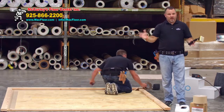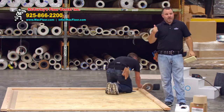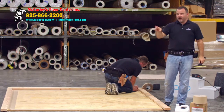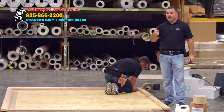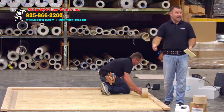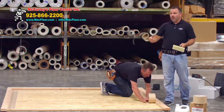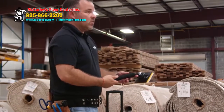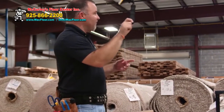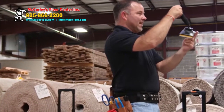Instead of a roller, we tried multiple ways. In a residential environment with raised baseboard, using a trowel gets a lot of glue up underneath the baseboard. We tried a flat trowel and a teethed trowel — neither worked. A roller gets glue all over the baseboards because it rolls right up next to them. So we started looking at different applicators. This is essentially a deck stain applicator with little edges that keep the adhesive off the baseboards.